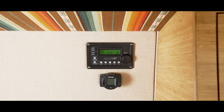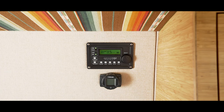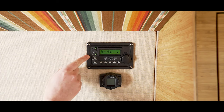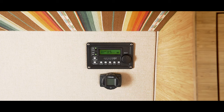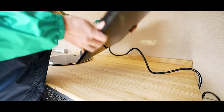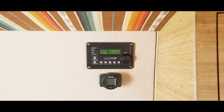When you turn the inverter on by pressing the inverter button on the bottom left, the display now reads inverting. You'll see that the green light is illuminated next to power and INV. You can now use your 110 volt outlets without being plugged into shore power. Remember that the size of your inverter determines what appliances can be used. For example, if your inverter has a capacity of 2000 watts or more you can use appliances that output that wattage or less. It's best not to use an appliance with a higher wattage than your inverter can handle.